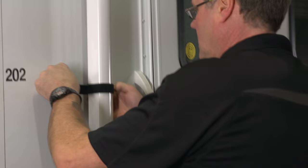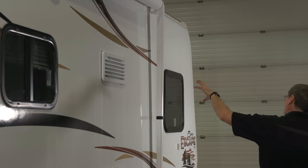Then re-secure our travel lock. With that, your awning is retracted, secured, and ready for travel. A mistake I have seen made is for whatever reason some people come by and flip that switch again. Now it is in the roll-out position and with wind speed it can actually pull out like a parachute and rip the awning off the coach. So when you flip the switch to retract it, don't touch the switch after that and it's stowed and ready for travel. I'll see you next time. Bye.